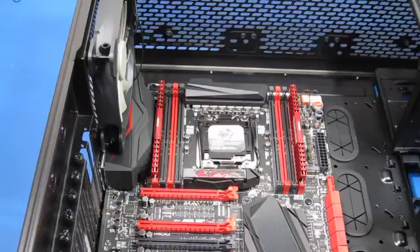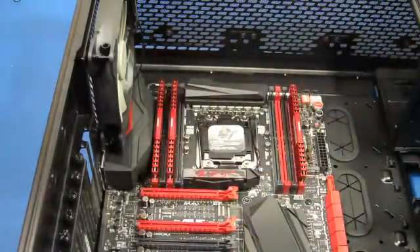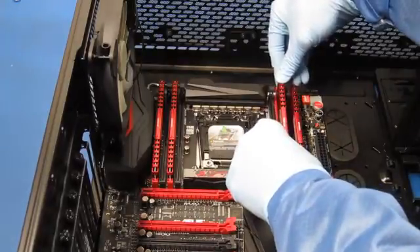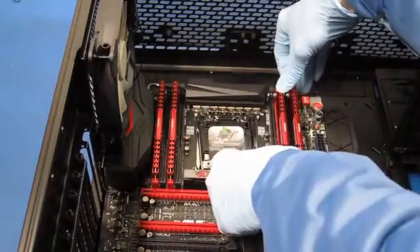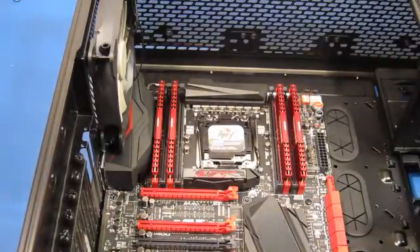We did get that right — the book says Channel 1, and I'm going to put them in like this. I put pressure at the back side here and then press it in, which causes the little latch to click in. It has a very positive feel to the connectors — some memory connectors aren't quite that positive. Okay, next is the CPU.